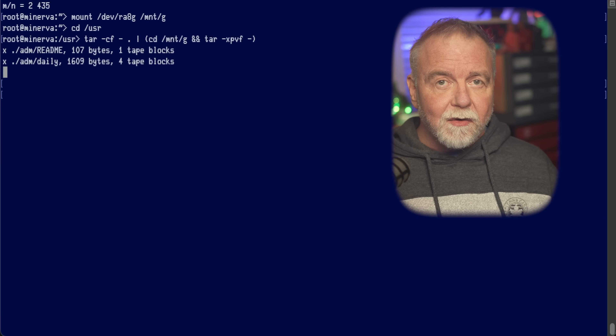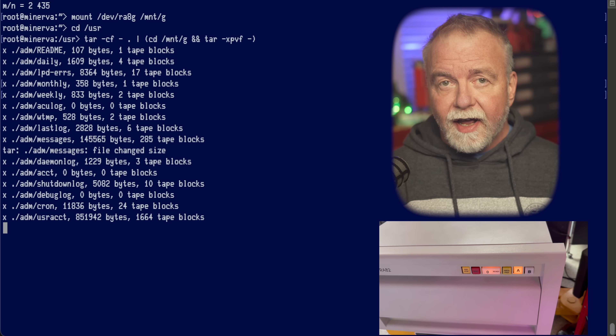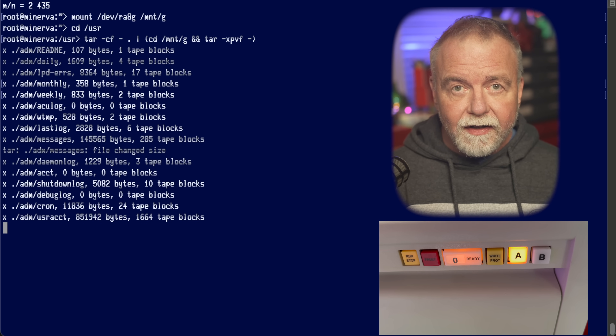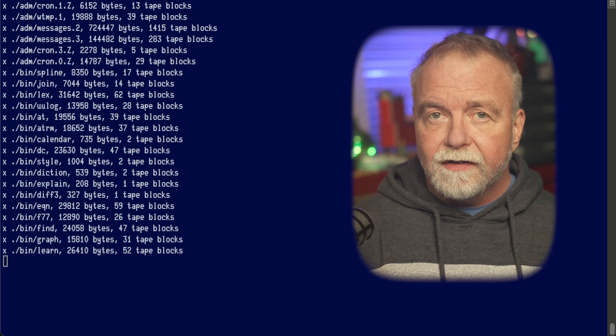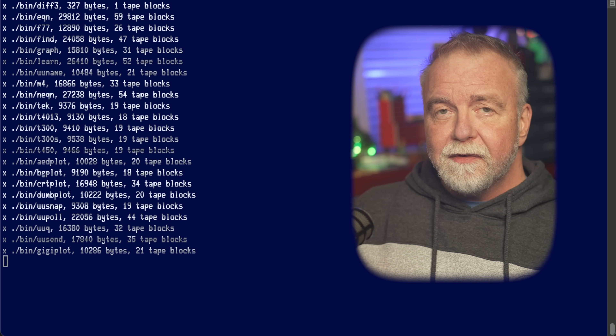Under load, the RA82 behaves like what it is - a very large, very fast, smart drive from the twilight of the biggest platters. It's quick enough to keep the PDP-11/73 happy, honest enough to tell you when something is wrong, and theatrical enough that you'll find yourself staring at its panel for no good reason. That fault button is not just decoration - the fault codes are very comprehensive. There's a reason all this still holds together. DEC did three big things right with the RA82. First, they made the media smart. With per-track spares, ECC, error detection, and sector headers that identify the logical block number, the drive itself can heal weak spots without making the host participate at all. The RCT centralizes the bookkeeping so you don't have to worry about it. I just don't know what happens if you get two bad sectors on a track - if you know, let me know in the comments.